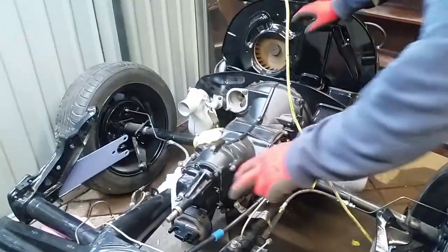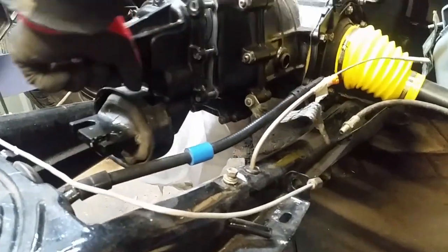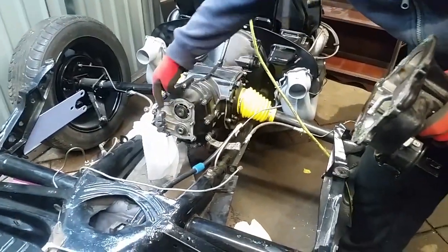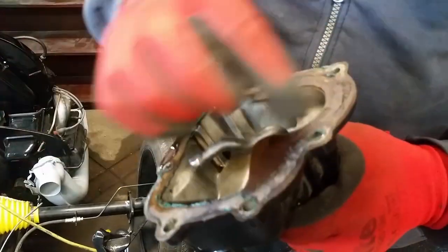All right, so Pope's nose, right? Here it is here, and this is it here. See? All right, it's coming off. Yeah, there we go. There's the gear selector. Now, that's got to go in between here, and it looks like this one here was supposed to be out when I selected them all. I make sure that it's in neutral, pop this back on, might put some sealant on here.